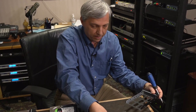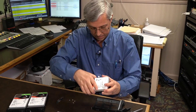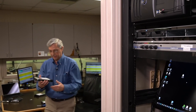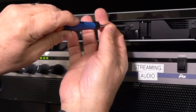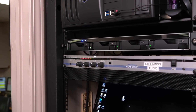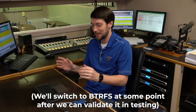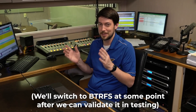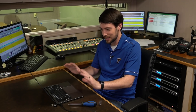Hopefully it'll still perform well — it shouldn't be a bottleneck on the gigabit network. We waffled a little bit and we're going to stick with RAID-10 on EXT4 for now, just because I've seen forum posts from other Asustor users who've had some issues with BTRFS in the past. I know RAID-10 is going to work. It doesn't have some of the nicer protections and snapshots that BTRFS does, but someday it'd be really cool if Asustor supported ZFS.